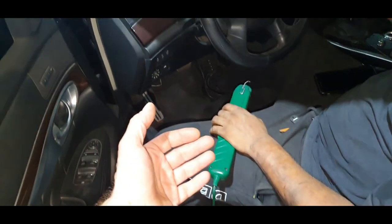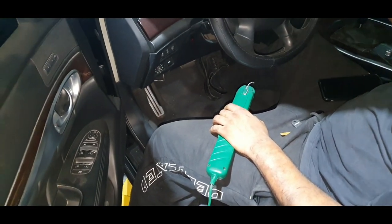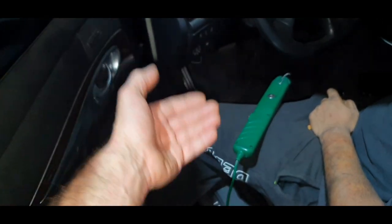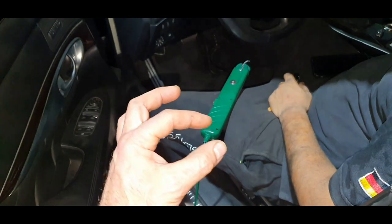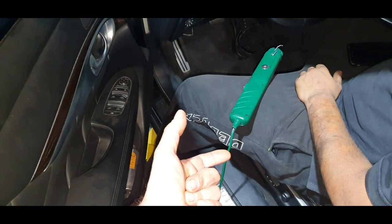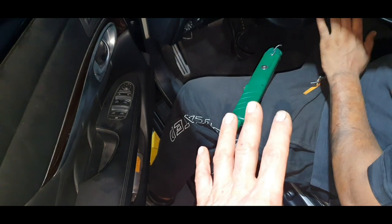What you have to do, you have to get the flywheel, the clutch, the pressure plate, mount it all together, put a scale under this, put it on the hydraulic press, get the dial indicator to see how much the stroke is and how much pressure it's applying from the pressure plate on the clutch. From there, you have to see how much material you have to remove by adding washers on the pressure plate. Let us say, if you put 0.5 millimeter and you raise the pressure plate higher, how much force is applied on the clutch, and how much you're supposed to remove from the flywheel, from the pad where it's stepping the clutch, not all over the place. So would you get my point?